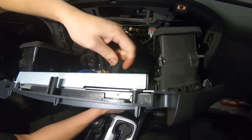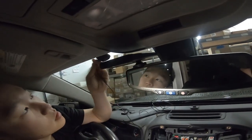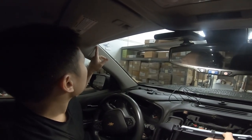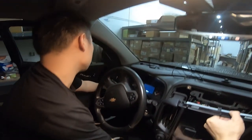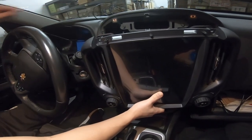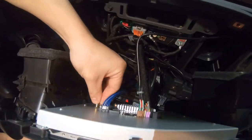Next is your GPS monitor. You've got to make sure you route it correctly. For the GPS monitor, take your GPS and connect it to the top of your windshield, wherever nearest to the top. Route the wire all the way from there down to here. Once you have that wire routed, take the weather stripping off of your car — you just pull this off. Then route it down here all the way to below your feet area, and then go straight up and try to find a place to put it through. Once you route the GPS through the bottom, you are going to screw it on to this right here.